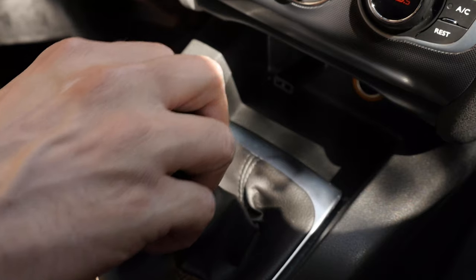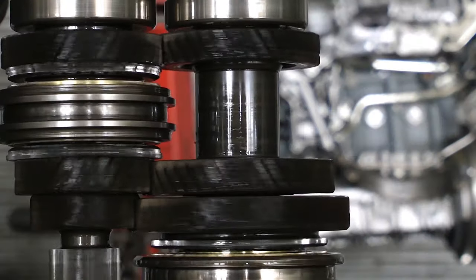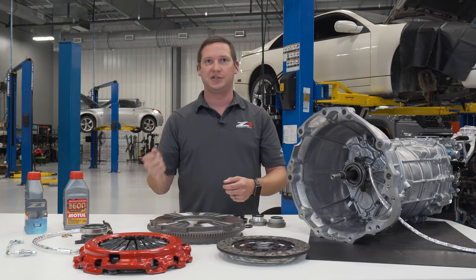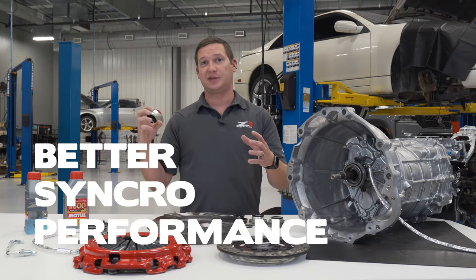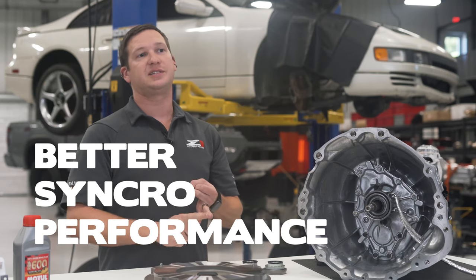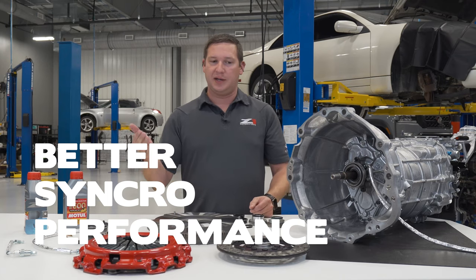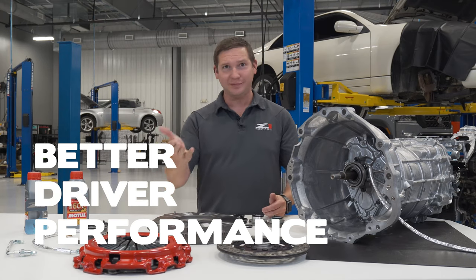If you're calling for a gear change — pulling that shift selector and putting pressure on a synchronizer — inside the trans you've got all your gears spinning together, in mesh all the time but not locked onto the shaft. You've got to get gear speed and shaft speed to match so you can lock that next gear and get the gear change done. When the disc is lighter, two things happen: the synchro, acting like a brake, can do its job better. You're quicker to slow it down and match speeds, less likely to grind gears, and synchro lasts longer. Faster gear changes, more direct, easier on the parts — means it lasts longer. It's a fun experience: not grinding gears, being quick like the pro you are.